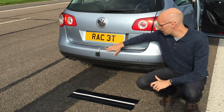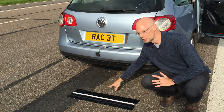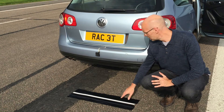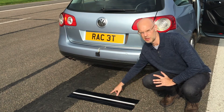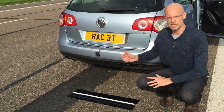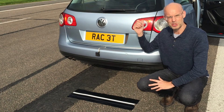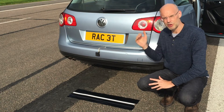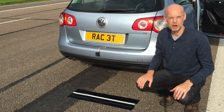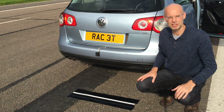On the rear of the car we have a laser sensor transmitting a laser dot directly onto the floor, looking for a reflection. On the road we've bonded a reflective strip — the laser comes down, hits the road, and reflects back up. As we cross over the reflective strip we get a time pulse which is connected to the speed boxes. As well as this laser strip, we've got one about 40 metres down the road, so as the car is driven down the road we get two pulses exactly 40 metres apart. We measure the distance between the centres very exactly using a class one tape measure and a laser distance sensor.